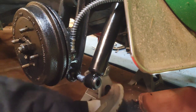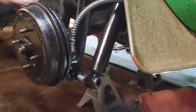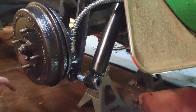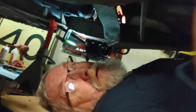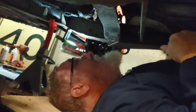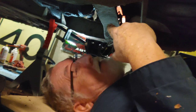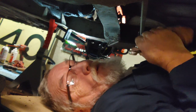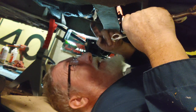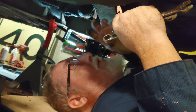Well, we got it started. I'm thinking I might have to go and attach them to the deck first. Boy, maybe I should have lifted this up higher. It's kind of tight under here. But I'm having a heck of a time. I got two or three of the bolts tight. But yeah, the bolts go in from the differential out toward the axle. And you got to get all the bolt heads through the flange so that you can rotate to get to the other bolts.